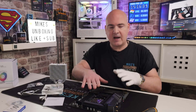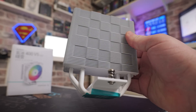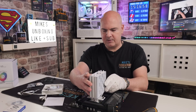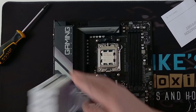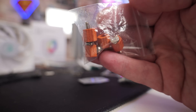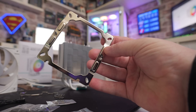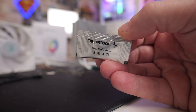Parts you're going to need: obviously your motherboard and processor already installed, and the tower itself. The tower has swept-back pipes to give you better RAM clearance, and it goes on with the swoop-back section towards the rear of the motherboard — towards your I/O shield — with the fan at the front. You'll also need the AMD fittings bag, which contains four long threaded screws and four brownie-orange spacers. You'll also need the universal top plate, which fits both Intel and AMD platforms. You'll also need some thermal compound — you can use the included Deepcool stuff or compound of your own.